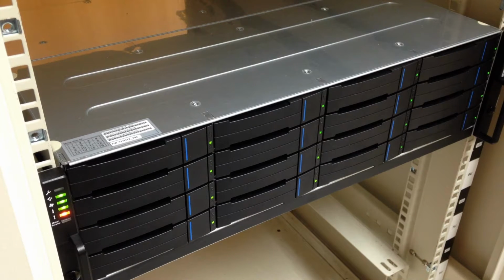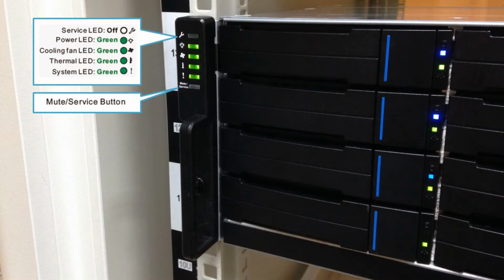Trays with hard drives will have their indication lights turn on in the front of the EonStor GS. There are 4 indication lights on the left. The machine is operating normally when they are a steady green. You can check what these LED lights mean in the quick installation guide.